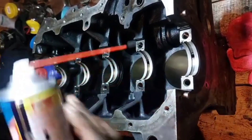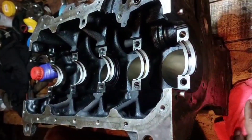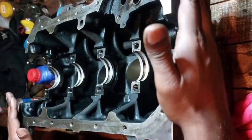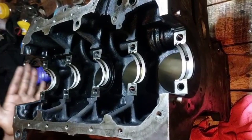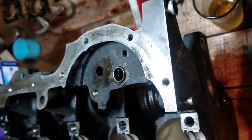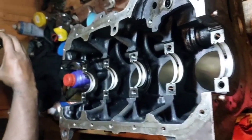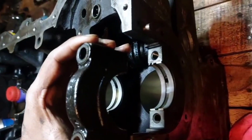I'm not going to remove the caps. I have some brake cleaner here, I'm just going to spray it up and then use a clean microfiber cloth, give it a good wipe, put some oil on it and continue. Before I go further, I want you to have a good look at this block. This part goes into the gearbox side and this side here is where your cam belt and stuff goes. The oil pump sits more towards the gearbox side. So we are starting: number five, four, three, two, one — that's how my caps are going to go.